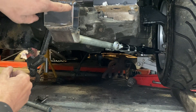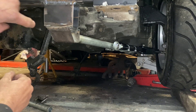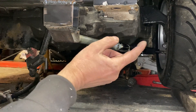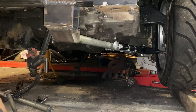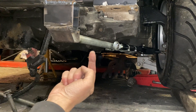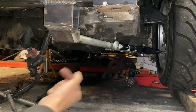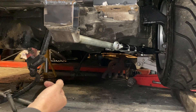What we need to do now to finish this off is make an end plate, tie in across this top edge here, same with here and the other side, and then two tie rods — then it can go back on its wheels and I can measure shaft lengths. I'm quite happy with the progress. We've got some one-inch CDS tube to make the tie bars with and from there we're not far off giving it back to Kurt for him to get on with his jobs. Let's crack on and see where this video ends up.